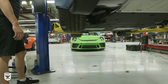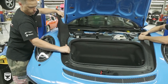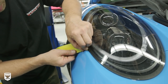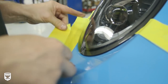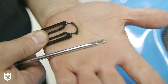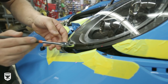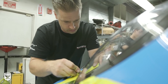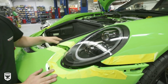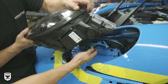Once the sanding and denibbing marks were restored, the cars were lifted for Brian and Nick to carefully remove the headlights. They first removed the side markers, under tray, trunk plastics, and then taped off the surrounding paint. Brian uses a tab puller to remove the plastic tab connecting the bumper to the fender, then with a few pulls the bumper was displaced enough to reach the bolts under the headlight. On previous models this could be done from inside the trunk with a long Allen key, but on the newer cars you have to pull off the bumper cover to get two 10-millimeter nuts underneath, then the headlight is pulled out and the electrical units detached.